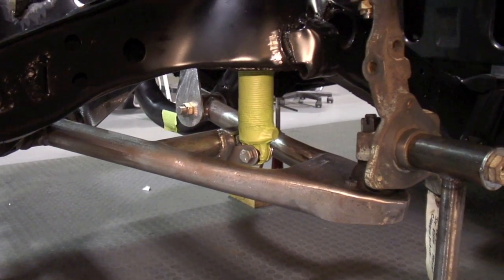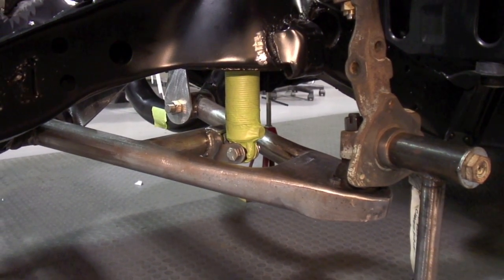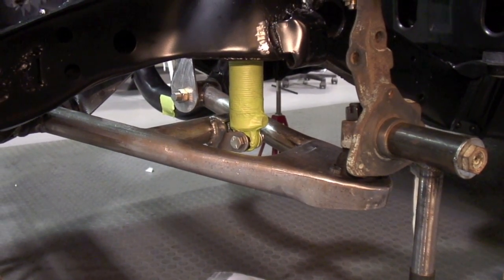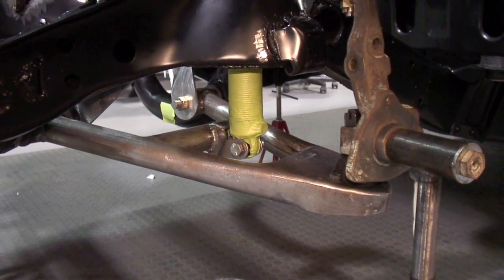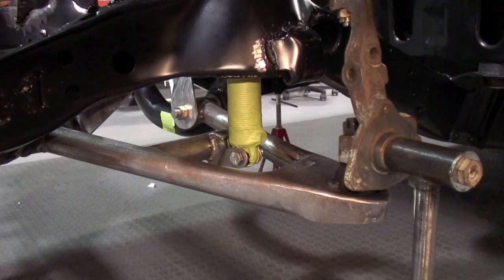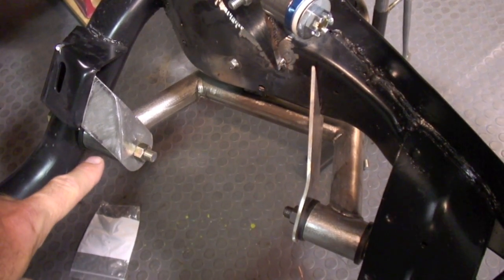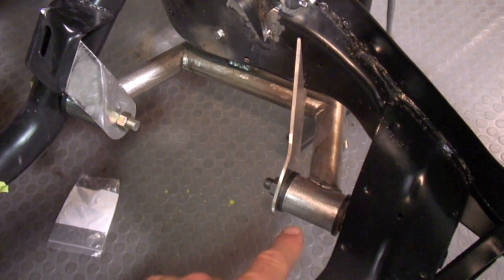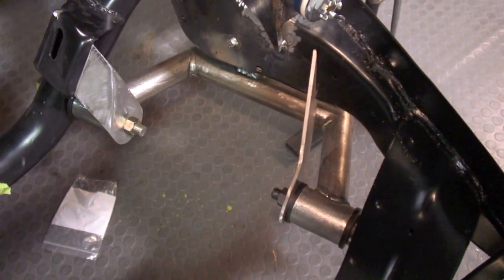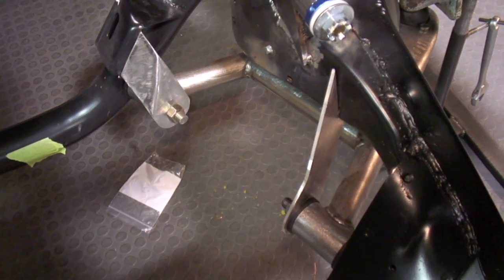From this angle you can see the lower control arm is welded and installed. Of course it'll have to be smoothed out and painted, but in the rough this is what it looks like. A big difference compared to the very large control arm the Galaxy originally came with — we'll show you that in a second. Inside angle, you can see special plates to reinforce the inside of the control arm so that it's not just bolted on the outer but also on the inside. We'll take a look at the original control arm just so you can see what it looked like.